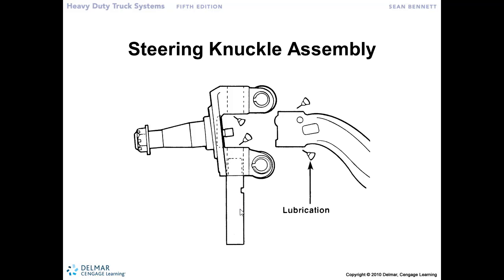A piece of advice: make sure that king pin is lined up properly. Here's the opening — the hole for the draw key that holds the king pin in place — and here's the notch where the draw key engages the king pin to keep it from turning and moving up and down. When you start pushing that king pin through, make sure that notch will line up perfectly with the draw key opening. If it's twisted just a little bit off, it is very unlikely that the draw key coming through will cause the king pin to rotate to the right direction.